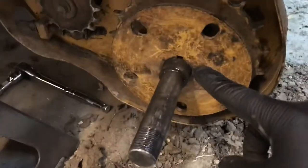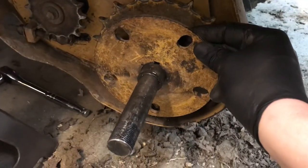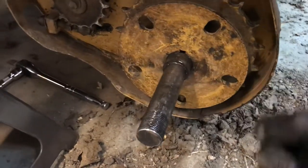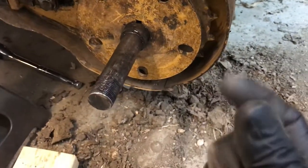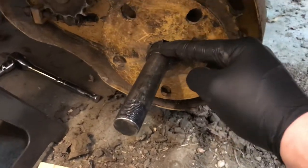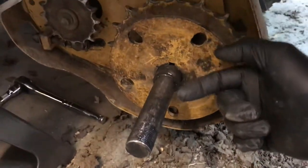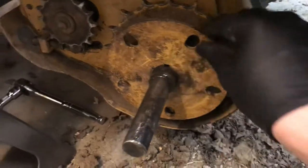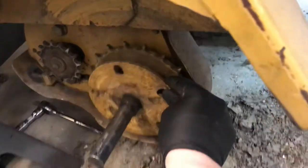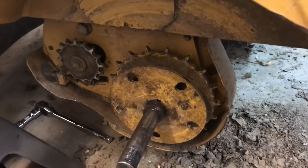I've already put in the new key. What you do is pull off this hub, and on the back, this little keyhole is a little bit smaller than the quarter inch, but on the inside there's a little over an inch hole gap on the top part and on the shaft where that key goes in. When you put the key on the back side, I just used a hammer and pounded it in, and it eventually seated inside there. Now when I spin the hub, it rotates the tires with it, so when this drive chain spins and rotates, it's going to have all four wheels turning and not just two.